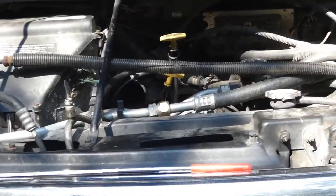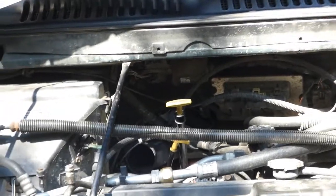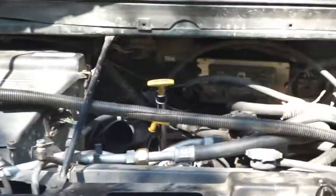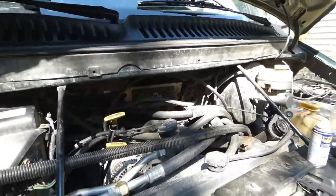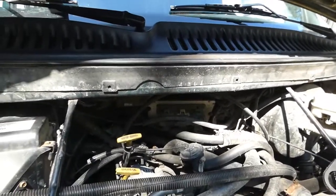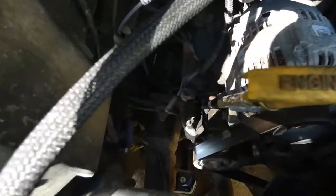The reason I'm doing this is a couple of reasons. I've been having a problem with intermittent, like a jerk — like a cylinder that's not firing. I did a tune-up last year. It could be many things. I put fuel injector cleaner in, and actually the last time I drove it, it didn't do it, so maybe that will clear it out. But this is something that I postponed doing as part of the tune-up, because I had trouble with those spark plugs. So I'm going under.